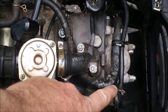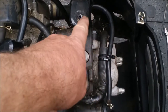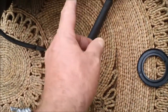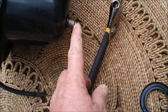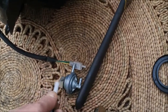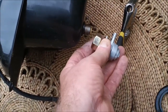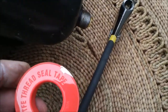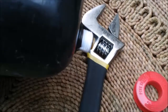I've taken the vacuum hose — the long length that went up to the vacuum petcock — and cut a length allowing it to loop around without a kink. I took off the old petcock and you can see the old fuel filter. The tank already had a filter, and being that this is a 2016 with only 3,000 miles, I'm going to leave the old filter in and just put the new petcock on. I'll apply thread seal tape on the threads before installing the new petcock.